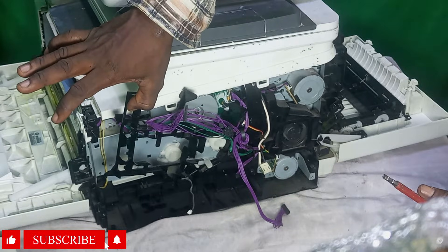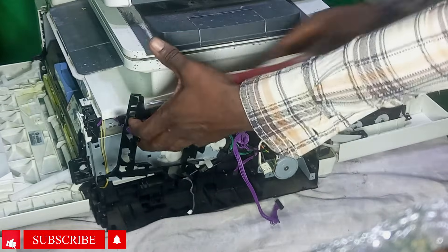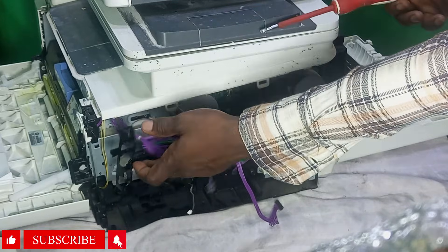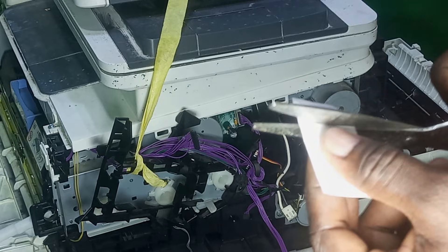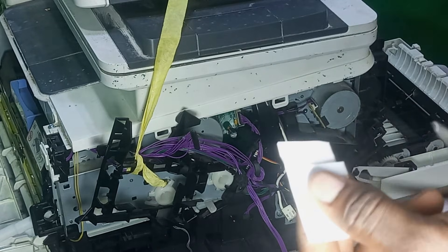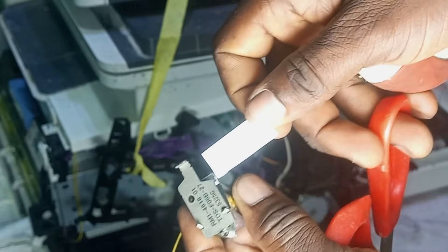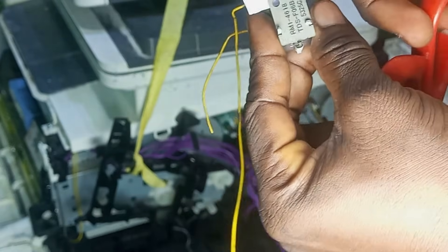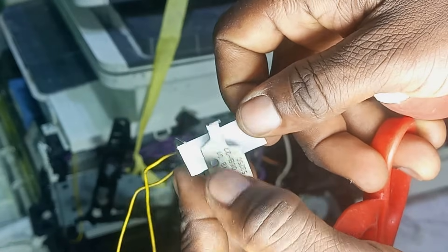So this is the clip — I'm going to hold it aside like this. The solenoid is right under here. So I'm going to cut out a piece of paper; that is what we are going to use to cover the sticky area on the solenoid. We are going to use it to cover it this way so that once the metal part moves back and forth, nothing is going to hold it down.